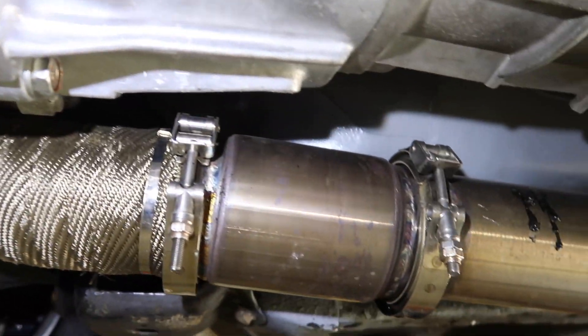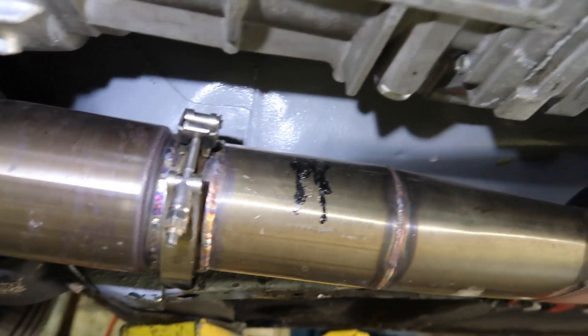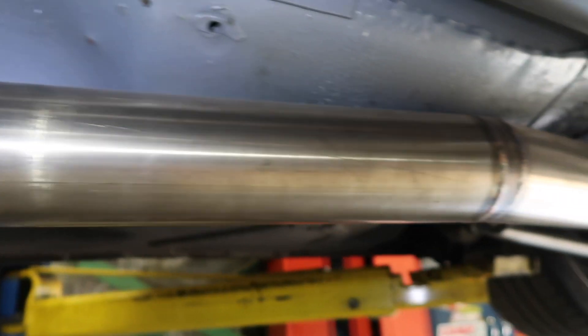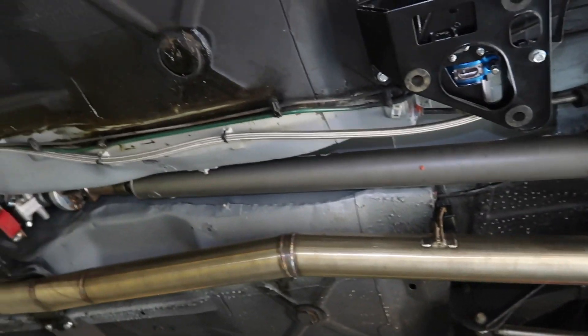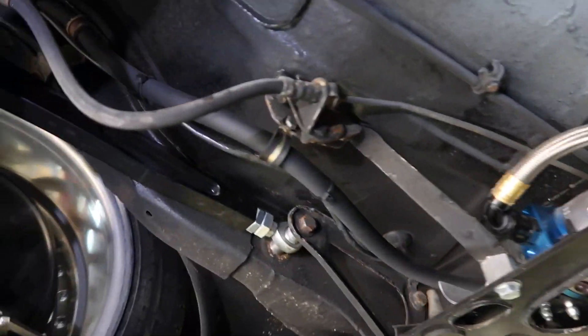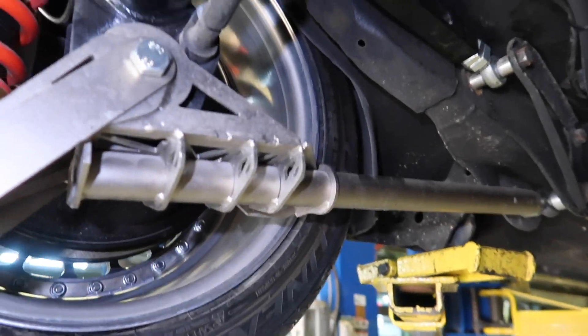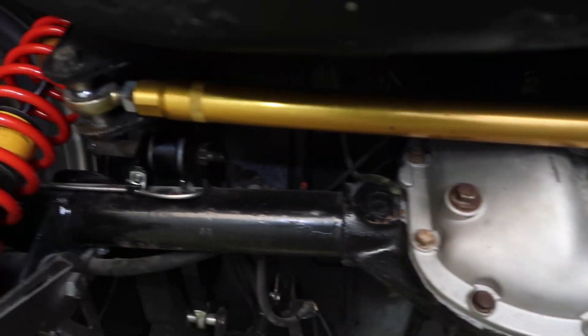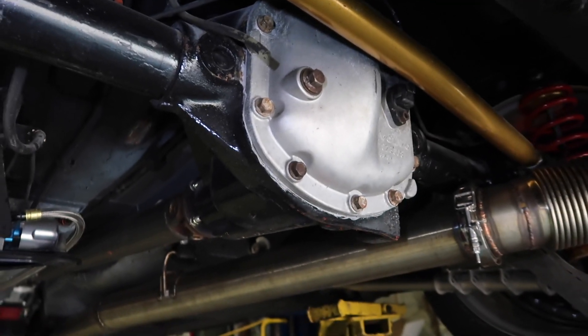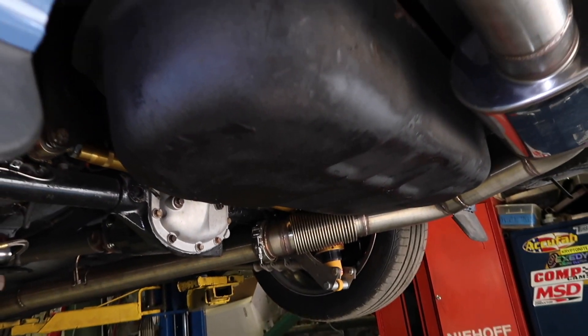There's a three-and-a-half-inch downpipe we made. It's a street car so it's got a cat and three-and-a-half-inch exhaust all the way back, with a little oval section just to keep the ground clearance good. Custom driveshaft from our friends at The Driveshaft Shop, and XRP fuel line to an IDF 750 filter — another signature move of ours. In the back, more Kaplinky Racing products: trailing arms and a whole three-link setup with an adjustable panhard bar. Koni shocks with the Kaplinky Racing kit. In the diff we used a Wavetrac limited-slip differential, and it's got a factory fuel tank with a Bosch fuel pump installed.